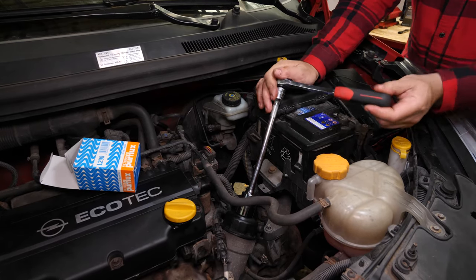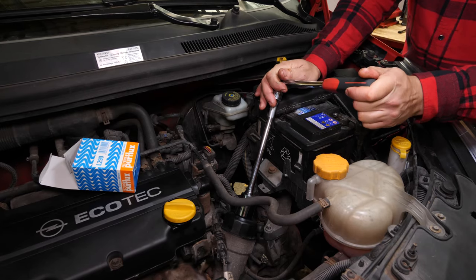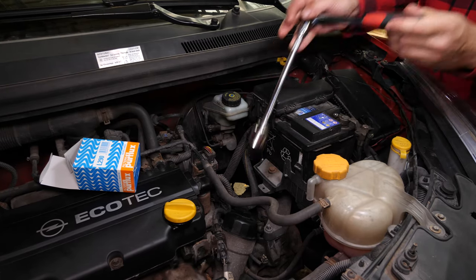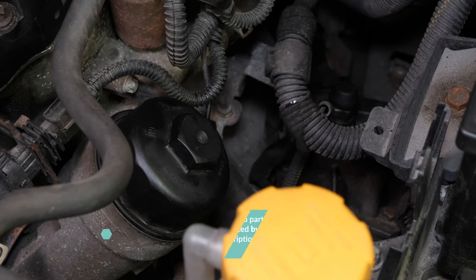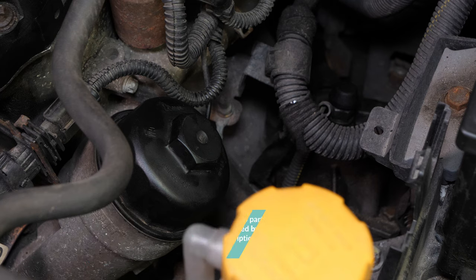For this step, you can also use a torque wrench set to 25 Nm. Careful! With this kind of oil filter, the new joint can be excessively thick, making the tightening process more complicated. As a result, you have to ensure that the flange washer is flat against the metal engine frame. Don't force it too much as the part is fragile.